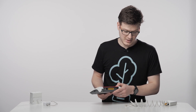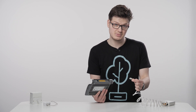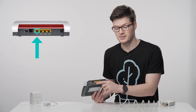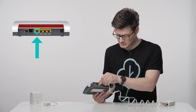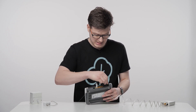Now you want to move the Fritz box over to wherever your ONT has been installed. Take the cable that you've plugged into the bottom of the ONT and — this piece is really important — plug it into LAN 1. It has to be LAN 1; it can't be any other port apart from LAN 1. Now that's plugged in, plug the power into the Fritz box and the Fritz box will begin to boot up.